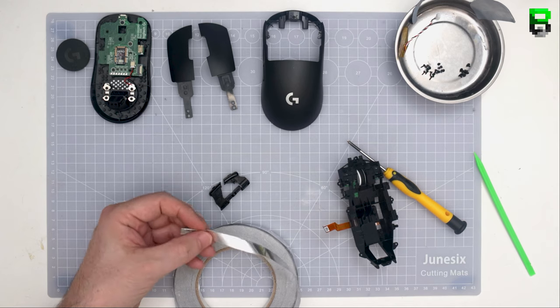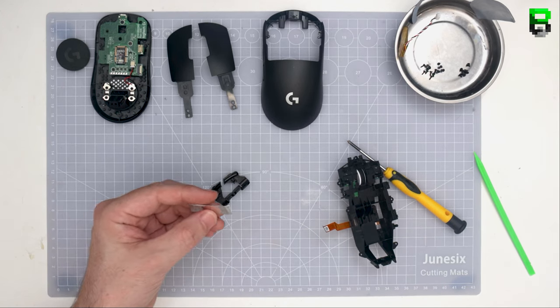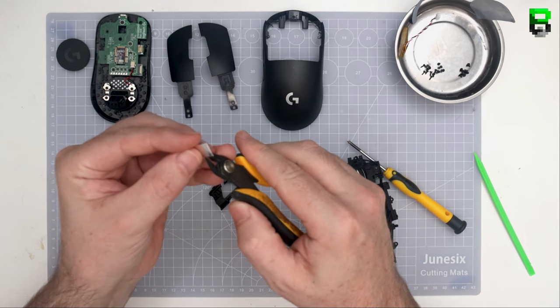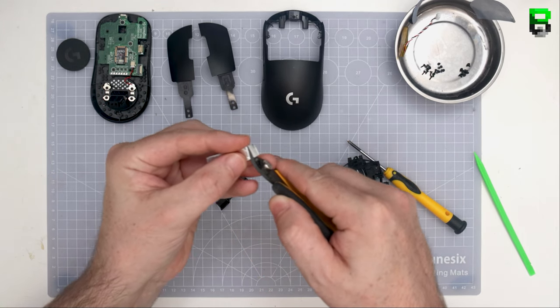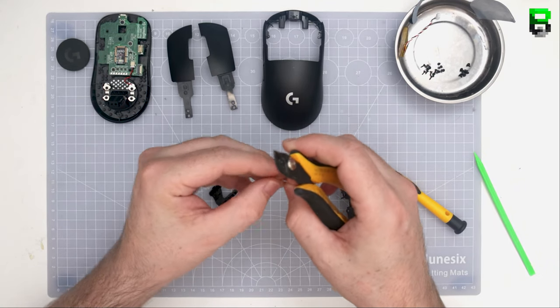There's different thicknesses of this tape. I'd try and get the thinnest tape you can. That way you can make the more micro adjustments that you need. And that way it gives you more flexibility when you want to change things or when you want to get really, really fine with your pre-travel. So it's single-sided, the Mylar, it's not double-sided tape.